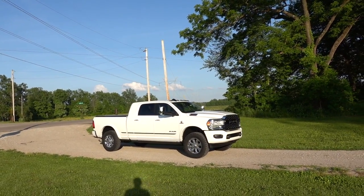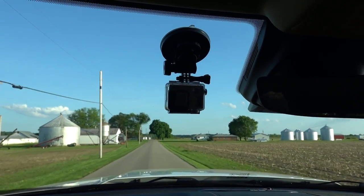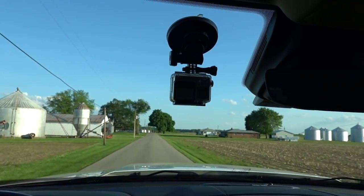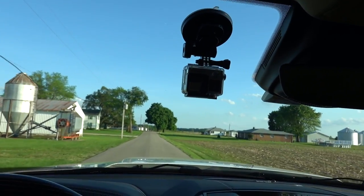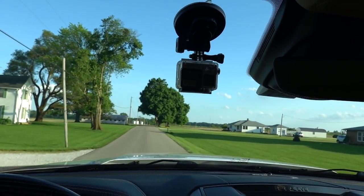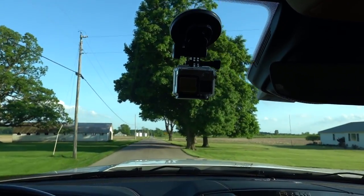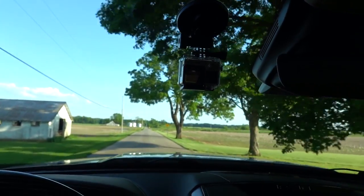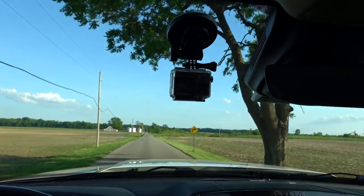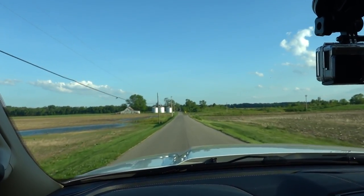With the 35s I don't have that issue anymore, even in the rain. I did drive in the rain and hit it hard one time just to see if it would break loose, and it didn't break loose as much. The traction control did come on, but my truck didn't fishtail. With the 295/60s they would fishtail — it was almost a little too dangerous. Not enough tire. Adding a little more height to the tire took away all wheel spin, so if you're looking to do burnouts you're probably going to have to re-gear.